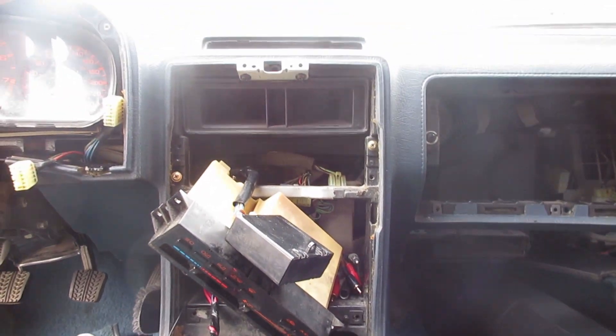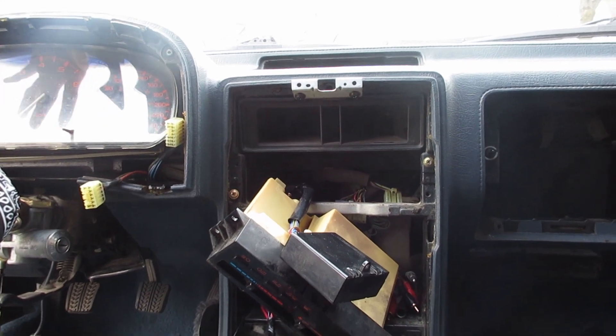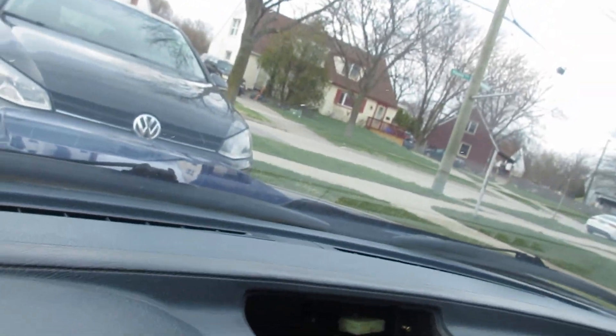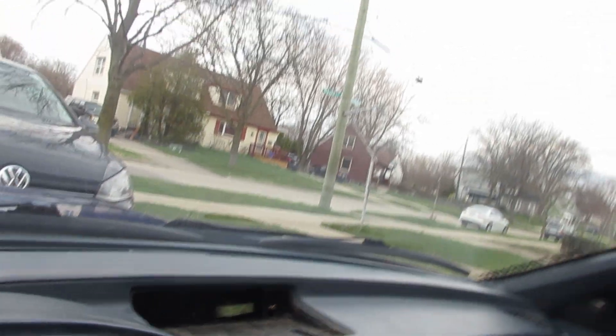Now about the plastic welding I mentioned earlier — you can see there's a crack here. As I go through the car I'm finding more and more that it looks like the dash may have been taken out before. I want to take a wood burner that also comes with a plastic welding kit to reseal that and give it more strength and rigidity. If you guys want to make any suggestions about that, I'd love it. The similar 10mm bolts are on the other side — just make sure you pop off the cover. I'm wiggling the dash back and forth and it still feels like there's some rigidity, so I'm not sure if there are screws or just clips holding it up top. Through the windshield there's a line that goes all the way across the dash and I'm not sure if that's a separate piece.